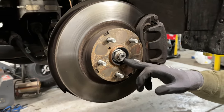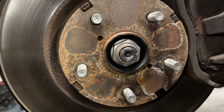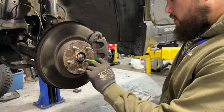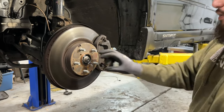If you look close over here, there's a locking mechanism. Usually that's punched in to prevent the axle nut from spinning back out. Grab yourself a punch of some sort and a hammer. We're going to go in there and try to hammer out that mechanism so that we can spin this 32mm off.